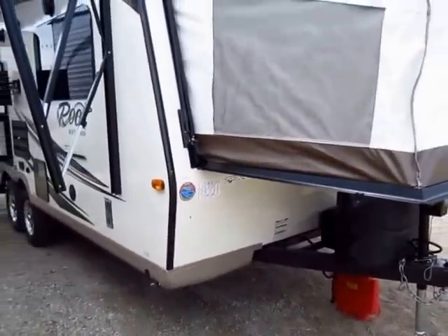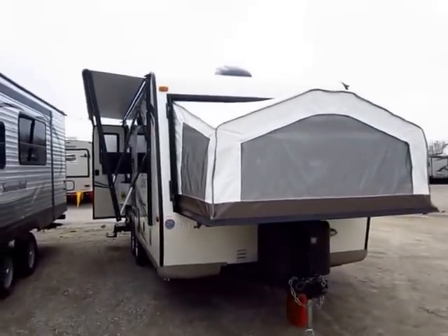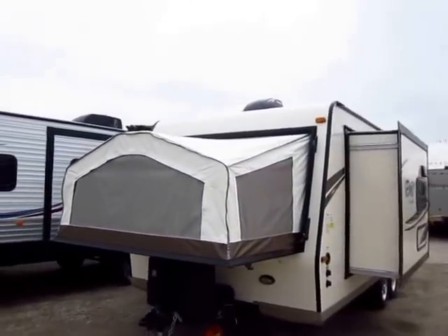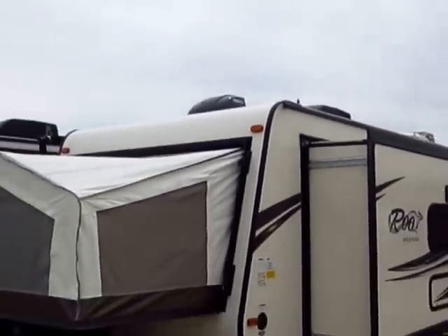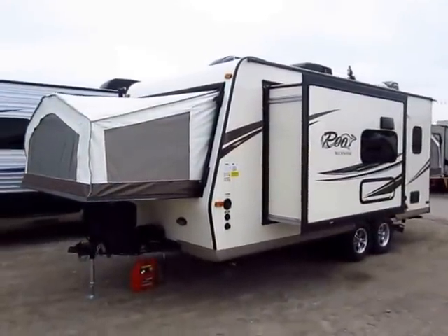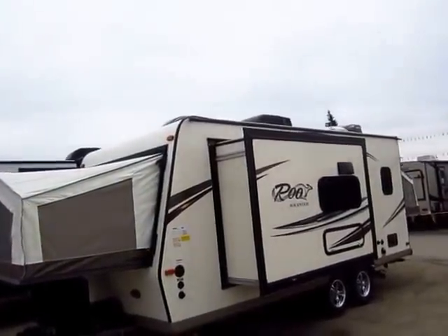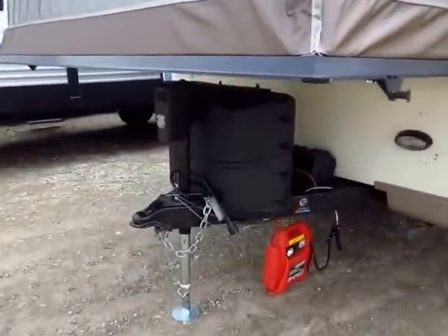This has a standard little solar charging station right here. Now this is not made to run your air conditioner and your fridge off the solar panel — you need serious dollars and cents invested to do that. It is made to work like a little trickle battery charger to keep your battery topped off if you are dry camping. Did you notice the Max Air covers on the roof? Anywhere you find a power vent fan in a Rockwood, you get the big vent fan — not the 4-inch plastic fan, but the big one that actually moves air — and then the roof vent fan built right onto it standard from the factory. That means you are getting their reliability, their guarantees, and a more worry-free experience.